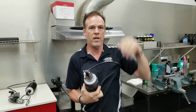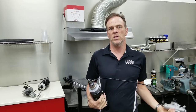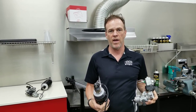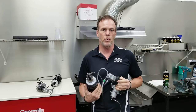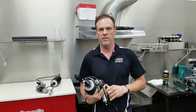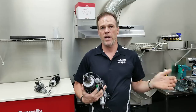So this is a spring preload adjuster. It is not a ride height adjuster. It's a misnomer to call it that, and people on the internet like to have an argument about that, but they literally don't know what they're talking about, so feel free to just ignore them. This adds preload to the spring. By default, it may change the ride height of the bike by adding spring pressure, but once the shock is topped out, it'll add more pressure and the ride height won't change.